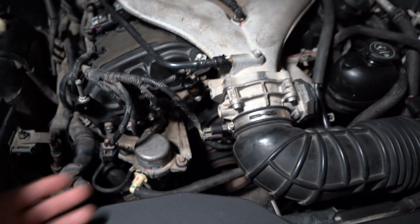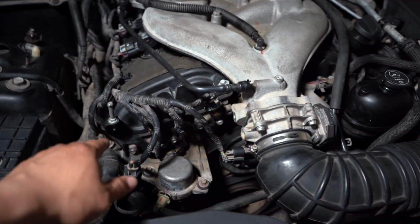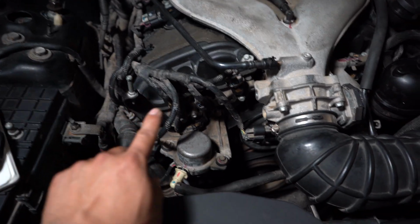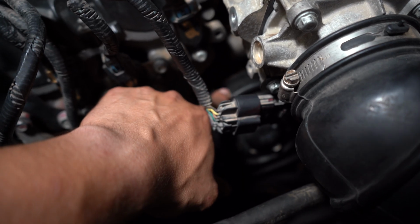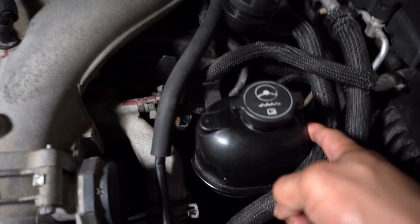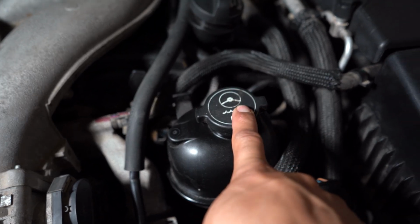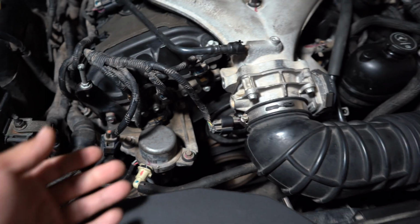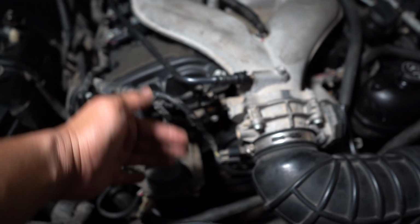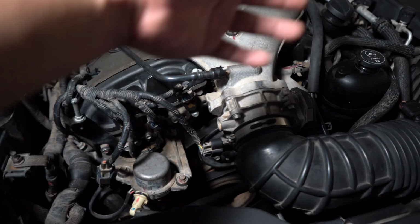Anyways, once you pull that, take off the water pump pulley, take off these 13mm bolts all around. Do not try and pry the cover. It has a pilot hole right above 11 o'clock of the water pump pulley. You put the big bolt you took off from here once, and you install it in there. That is called the pilot hole. The whole cover comes off when you crank it. It's a pusher, it pushes it out. Don't try and pry it on the sides.